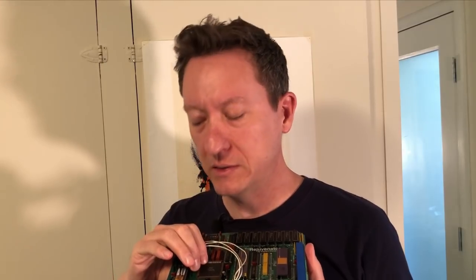Or the super Fat Agnus, or as some might call it, the obese. Which I always thought was a little mean. I hope Agnus had left the office by then at the Amiga team. In any case, you've got your chip RAM. Now you've got your Fat Agnus in there. You've moved these chips up. And then you've got a couple of these wire leads that you have to clip down below. That's it. You don't have to cut anything. There's no soldering, like I said before.